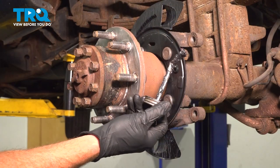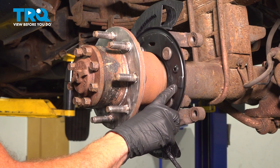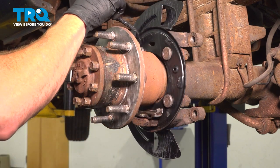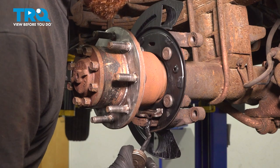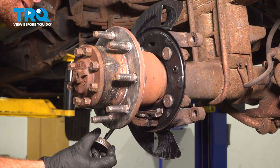Let's continue on with our lubricant. You'll find on your backing plate you have several raised areas. We'll be lubricating those because that is where the shoe will sit. This is going to help with vibration dampening and noise reduction. We'll also make sure we get down inside this area where the shoe is going to sit up against, and along the forward side.